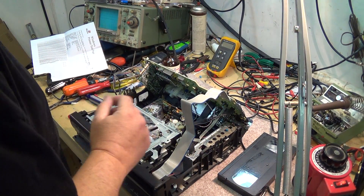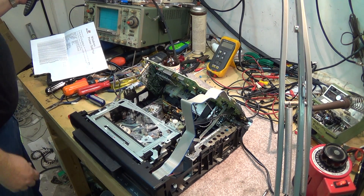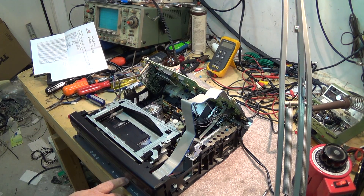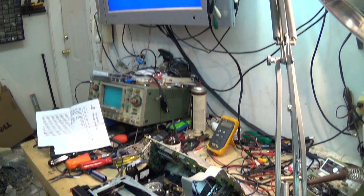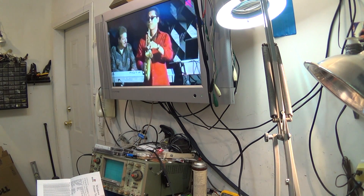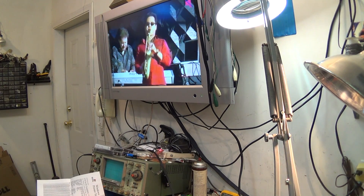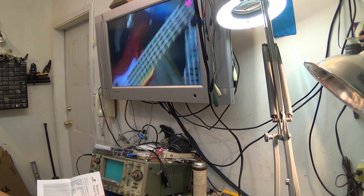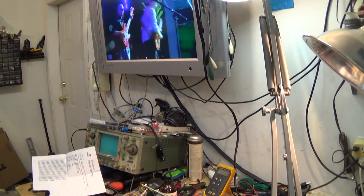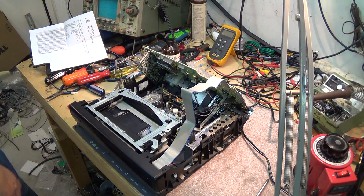The head has gotten a lot cleaner, so we'll reinstall the tape. I want to see whether our problem was just a dirty video head. We'll switch the monitor back to the analog VCR source, enter play again — and there we go. Our problem on this one was just a contaminated head, and that solved it. I was thinking this was going to be a little more serious, but I'm glad it wasn't. And you guys get a nice, quick, easy-to-follow instructional video on how to clean a video head. Now let's clean the audio control heads while we're at it.